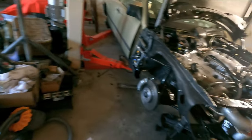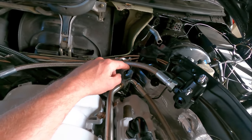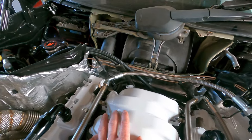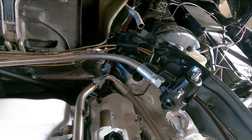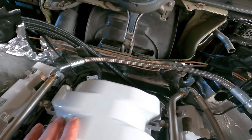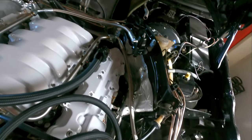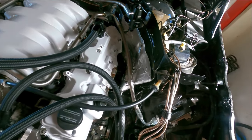I am going with my initial plan. I have these hoses pressed - PTFE half-inch lines connected to the AN8 connector. The exact size I can put below the video. This is a PTFE line, pressed by a local company here. This hose can handle 140 bars of pressure. More than needed, but pretty safe. They don't age, so they will last for many many years. I am really pleased with this.